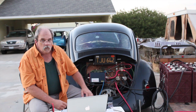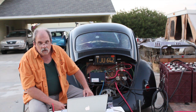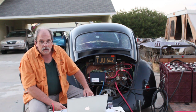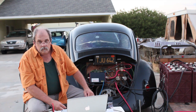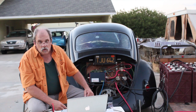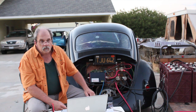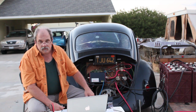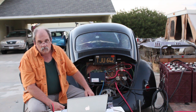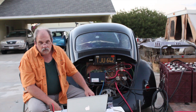I'm going to set the voltage level to 144 volts maximum voltage to the motor, even though we have a 192-volt pack. That will give us a sag pad. So when we accelerate and the batteries sag, my motor is going to see a good solid 144 to probably 156 volts, and all the way up to 900 amps. I've pulled up to 700 amps out of these batteries — that's about all I'm going to pull — so I'm going to limit my current to 650 to 700 amps. That's about all these batteries are going to give anyway.